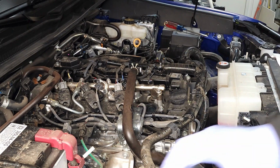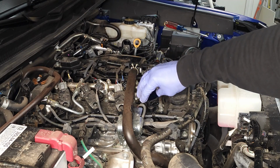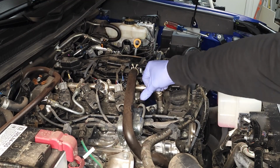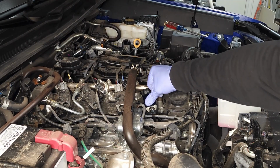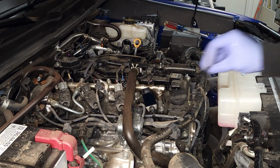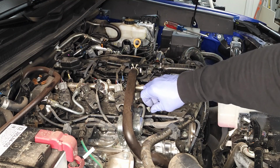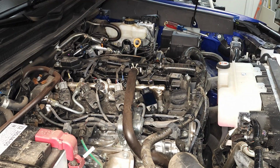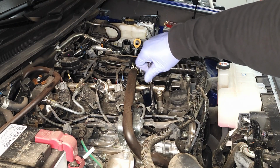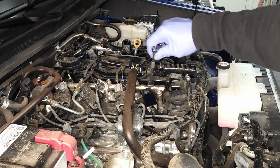Okay, let's get this coil installed. It's already pre-inspected. Slide it in carefully. There you go. Press it down. Got my bolt hole lined up properly this time. Now I grab my 8mm bolt. Get the bolt started by hand. Socket, ratchet, and extension. There you go. This just has to be snug.